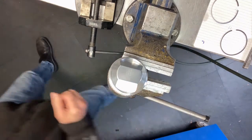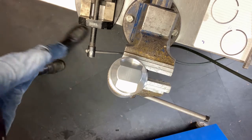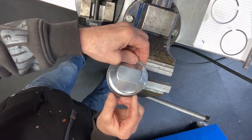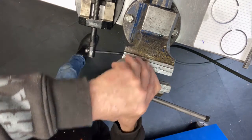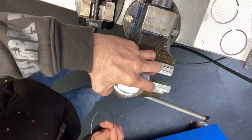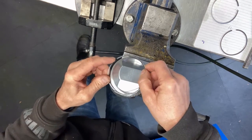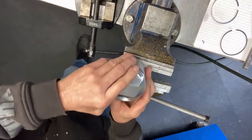Here I'm placing the oil control rings. These are three-piece Hastings oil control rings. The installation is a bit different than a standard oil control ring: first install the spacer, then spiral down the top steel rail, and finally spiral down the bottom steel rail. You can't use an expander tool on these steel rails. According to my machine shop they should do a very good job of controlling oil consumption. Note that I also drilled some oil drain holes that break out beneath the bottom oil rail to improve oil control.